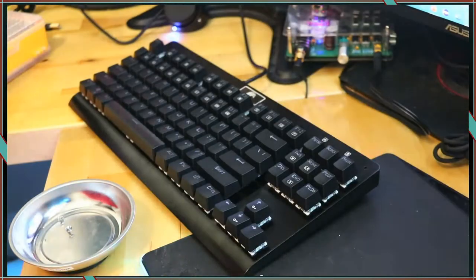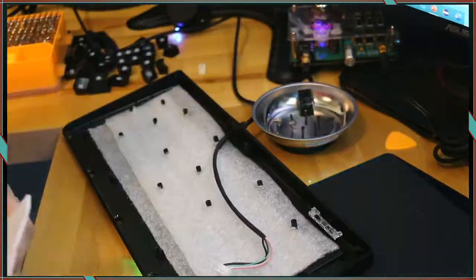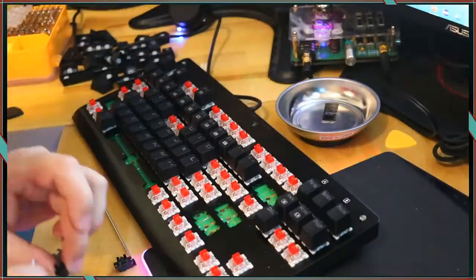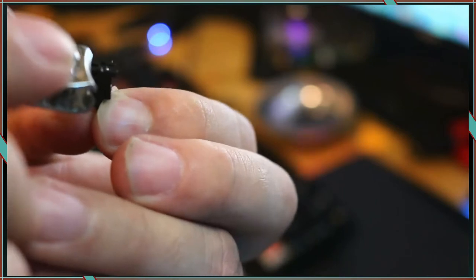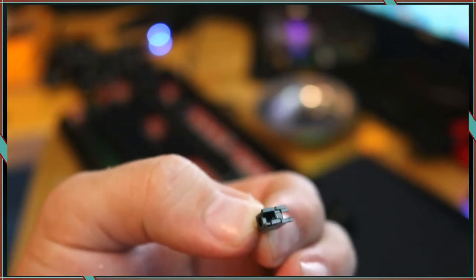It was a little more difficult to open as there was a screw underneath the Falcon symbol, which required a heat gun and a razor to get access to. After opening the board, I placed multiple layers of foam in the case to help dampen the keystrokes. After I screwed the plate back down, I removed all the stabilizers and clipped the spurs off the stabs. This allows for a flat stabilizer to hit a flat PCB and create a more stable feeling and sound.